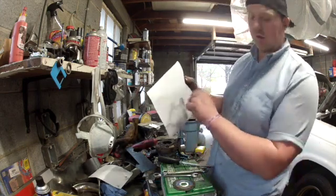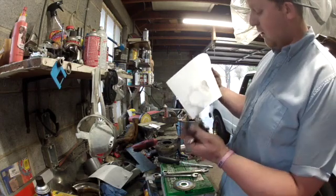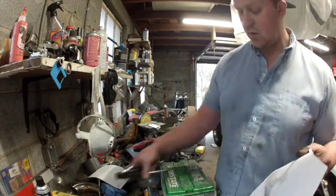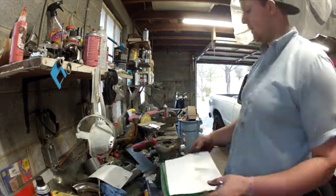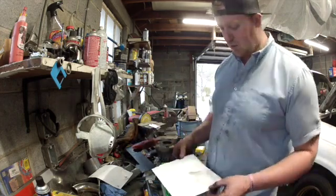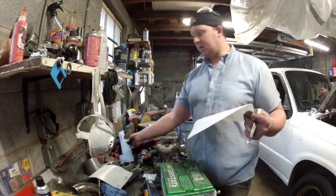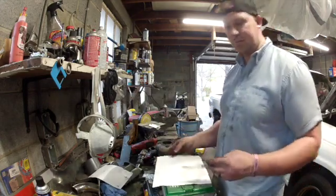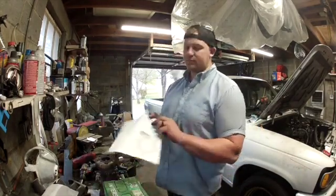And then you can just take a razor knife, like I had somewhere, like this right here, and put this on a flat surface or whatever, and literally just cut it out, and then you'll have a good template. It matches up perfectly to this, and then you can trace this. Once you have it all cut out, just trace it over to the piece of steel that you are working with, and it's as simple as that. So that's the easiest way that I have found to do this, and like I said, works like a charm.